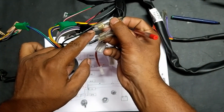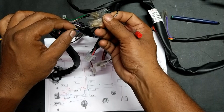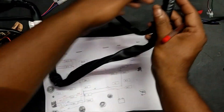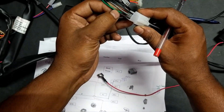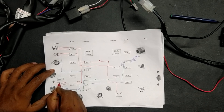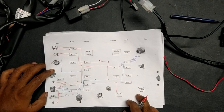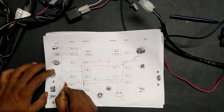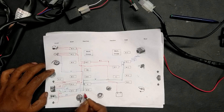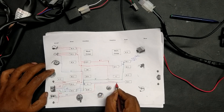We can take an output and connect it to the indicator — black-green is for right and black-white is for left. These two wires move through the wire sleeve and reach the W85 joint, where they get connected to the front indicators.